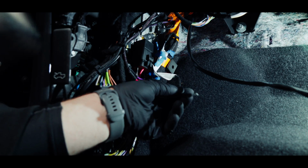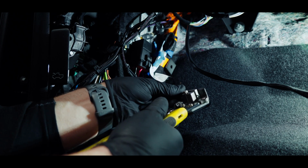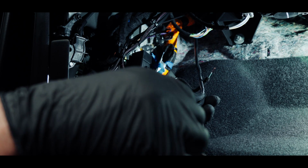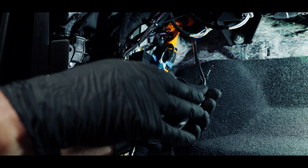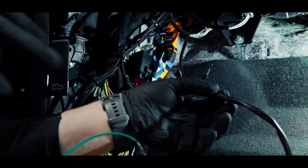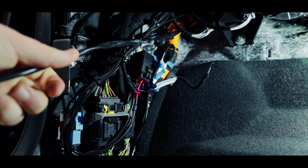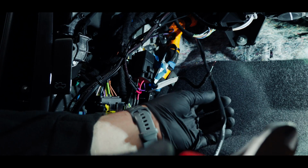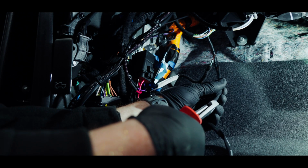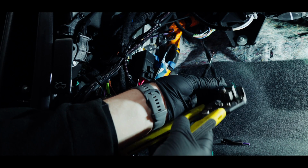So our green wire, chop the pre-heat shrink off it, use our wire strippers. So with the wire that we pull through the firewall, I'm just going to pull as much as I need through and just gauge it on the other side to make sure I'm happy with the length, so I'm not cutting too much off or too little. Now I'm happy with my length, I'm just going to cut this wire and then expose the green, and then wire strip that one.